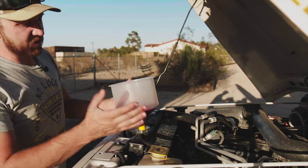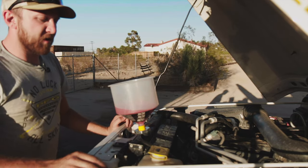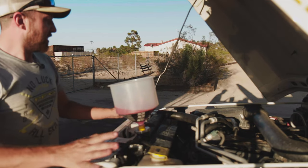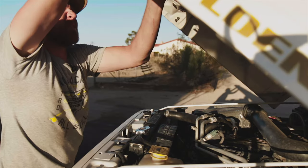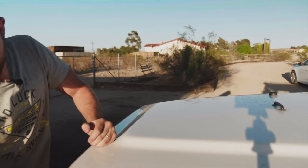That is hot! The temperature never got above 210, so that's encouraging. I flushed the overflow reservoir and put a good 50-50 mixture in it. I think everything else is pretty good. So there you have it — that's how you perform a pretty extensive coolant flush on your vehicle when it really needs it. My Jeep really needed it; that fluid in there was nasty and it was only about 8 months old. Something is getting in there or something loosened up when I put in the new coolant. The initial test showed with the AC running it was sitting a little to the left of 210 — about 198 according to a scan gauge in past tests.